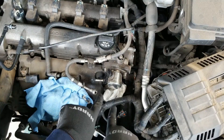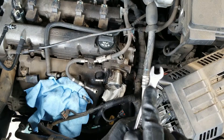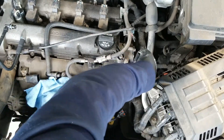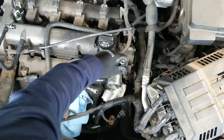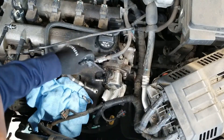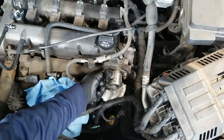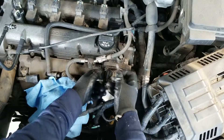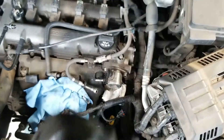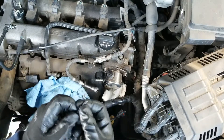All right, just like that — voila. You can see these markings inside; that's fine, that's exactly right. Now we have the fuel lines disconnected. All we have to do is take the fuel pump out. The fuel pump has two bolts holding it in place and they are number 10. Yep, they're number 10. I'll get a socket.